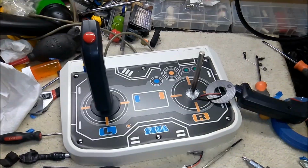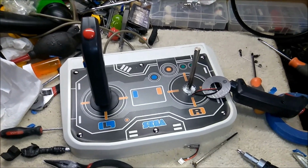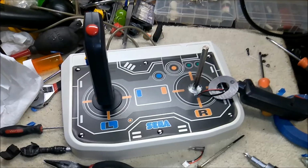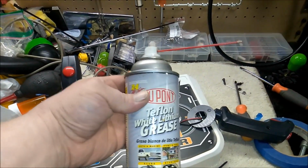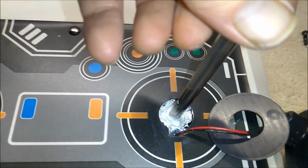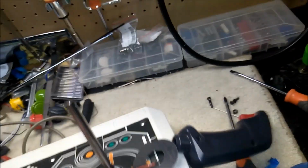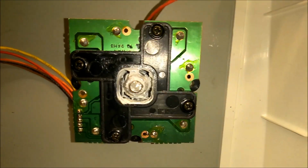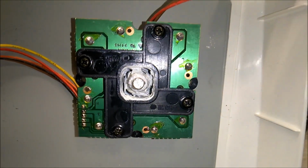One more thing. If you find the notion of removing the E-clips prohibitive, you can always try spray lithium grease. So the notion being that you would tilt this up, tilt it around, try to spray as much in the cracks as you can, flip this over, spray as much down there, as much as seems reasonable down there at the spring stopper.